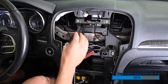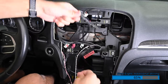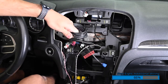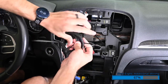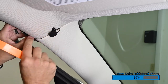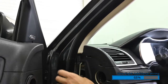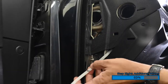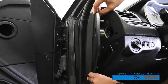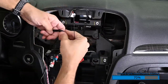Place the GPS antenna inside the dash and attach it to the large metal bracket. Following MECP best practices, take the excess GPS cable and make a loop, then twist the loop into a figure 8 and fold it back onto itself. Using zip ties, secure this loop — this will help cancel out any electromagnetic field that the coil cable would create. If you choose to install the optional extended microphone, attach it to the top of the A-pillar, then run the microphone cable down along the weatherstripping. Using a dash snake or long zip tie, attach the cable and fish it through the dash to the radio opening. Then reinstall the side trim panel. Pull the cable to the opening in the dash, then zip tie the excess cable to keep it clean.